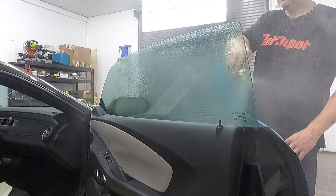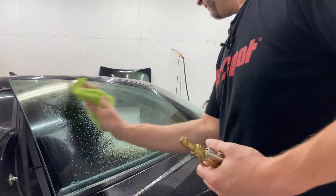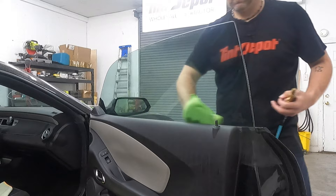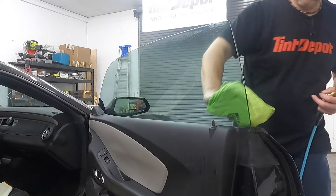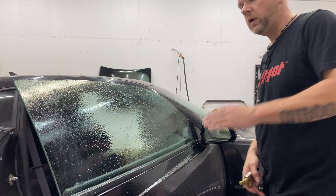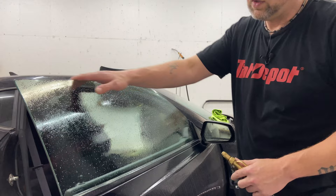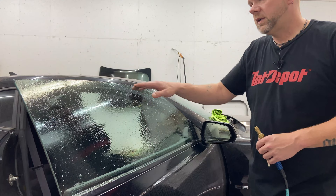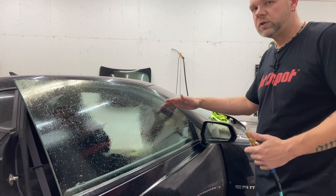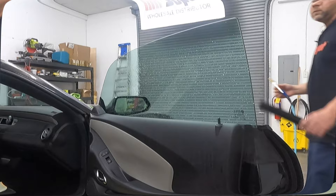The first thing we need to do is soap and water on the outside — wipe down any grime. Clean these top edges off really well, as you do a full peel, not a half or a two-stage, when you install this type of film. You want the glass pretty much as clean as you can get it without going overboard. We're going to wet the outside. I've already cut a 44-inch length of film that's going to cover front to back off a 40-inch roll, and then I split that in half — a piece for this side and a piece for the driver side. Now we're only doing a single cut on this side. I don't like to double cut frameless doors — it's a little heavy on the film, it can get janky, and I've seen windows that didn't line up well with a double cut. I want full control of the knife, the tint, and the blade.